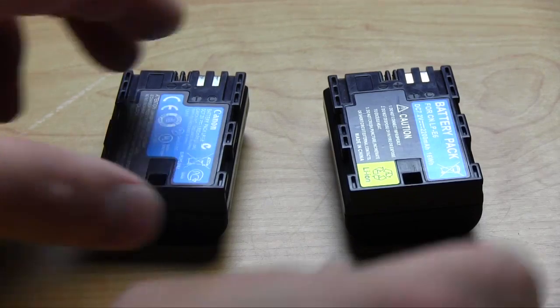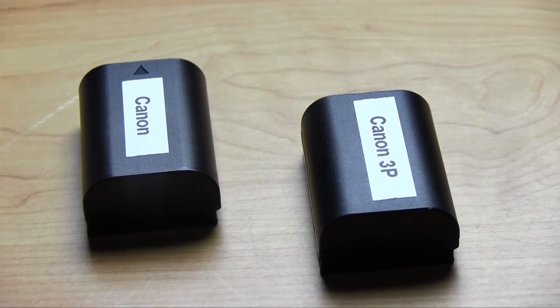For example, having a Canon 5D Mark II, I have batteries for that. If anyone knows the Canon LP-E6 battery, the generic ones aren't the same as the Canon OEM ones. The OEM ones allow the camera to interface with the battery and know how much time is left. The OEM recharger only interfaces with those specifically. So if you get the generic ones, they'll work, but only on their generic charger — so you want to keep those two separately. If you have a crew that doesn't know this, you might end up with problems. Having labels on the chargers and batteries makes things a lot simpler.